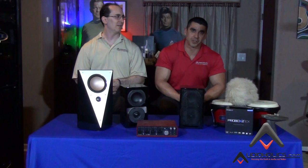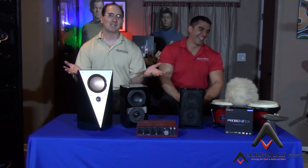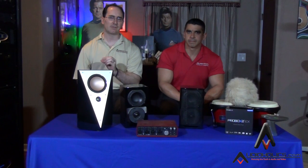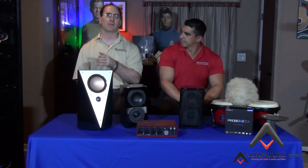Please accept this water. This is your prophecy today: do not use that switch. Let me tell you a little bit of history of why that switch exists. We started covering this topic for the Denon receiver video that we did, but we promised to go ahead and cover it in more detail. So basically, a lot of these AV receivers that are coming out today have this thing called an impedance selector switch, and the whole reason why that switch is there is so they could stamp "four ohms certified" on the back of the receiver.